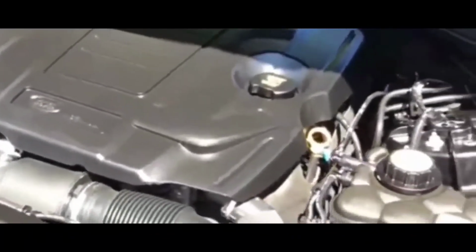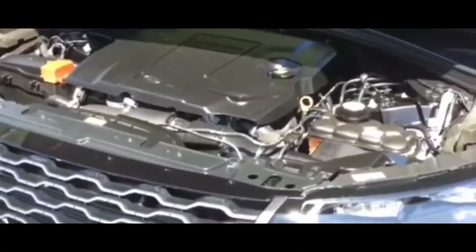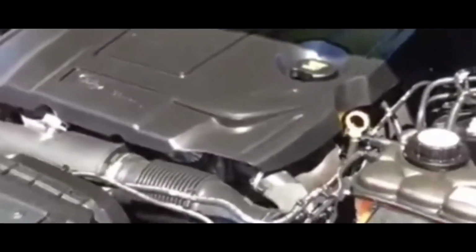So I was like, okay, let's move on. Maybe it's the ground wire, because a disconnected ground wire, not strong enough ground will cause these kind of situations to occur. So I was looking and trying to figure out where the ground led to the frame of the car. And normally the main ground would be the negative line from the battery terminal. It would ground to the frame of the car. And that was fine. It wasn't disconnected. It was bolted on tight. I didn't see too much rust on it. I kind of just threw that aside. I just thought it was a given that it was not the ground wire that was the problem. Fine. So at this point, it's not the battery, it's not the alternator, it's not the ground wire.